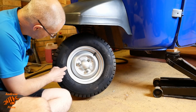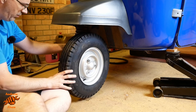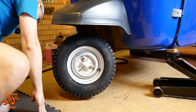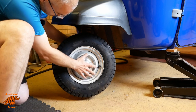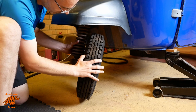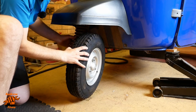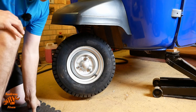While we're doing this we can check for any perishing cracks in the tyres — more common on vehicles like this that don't tend to cover loads of miles. Check for any obvious damage in the tread. Same check on the other side. Then check the steering head bearings — this involves grabbing the whole thing and trying to rock it backwards and forwards at different places throughout the steering arc. There's no movement there at all, and no flat spots in the bearings as you're turning, no catching at any particular point.